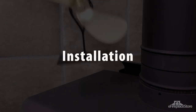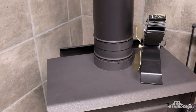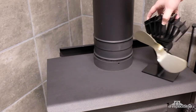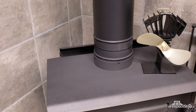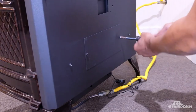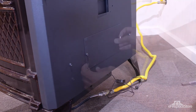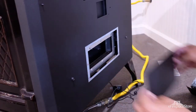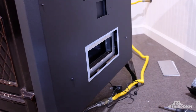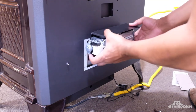How do you install a stove fan? Installing an appliance top thermoelectric fan is simple. Just set the fan on top of the wood stove in the spot specified by the fan's manual. After placing it, let the stove heat up, and once the base is hot enough, the fan's blades will start to spin. Model-specific blowers powered from wall outlets have a more involved installation. Always be sure to check both the stove's and the blower's installation manuals, and in particular, make sure the thermal switch is positioned in the right spot.